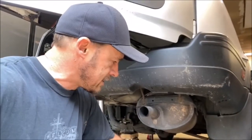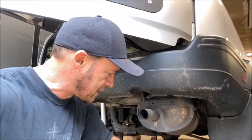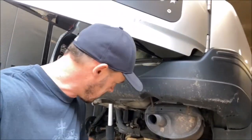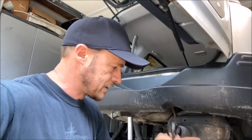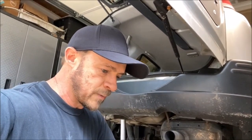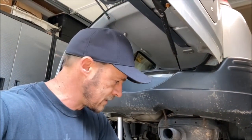The important thing to remember on these is the first thing you want to do is the subframe kit — it just makes everything fit better once you're done. So we'll do the subframe drop in the back first. We're going to do a one and a half inch subframe drop and then a three inch trailing arm drop, along with our upper control arm bracket relocation kit and our toe adjuster bracket kit. That's just to help it handle better on the highway.